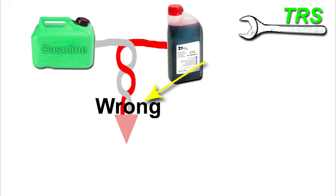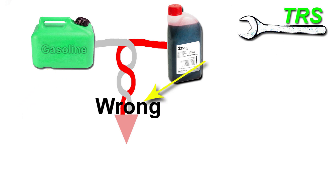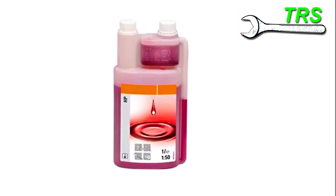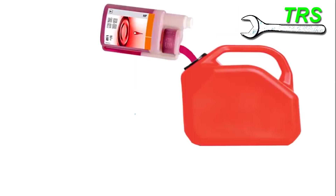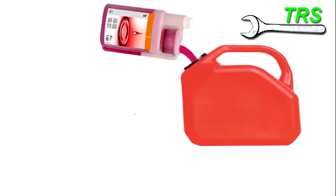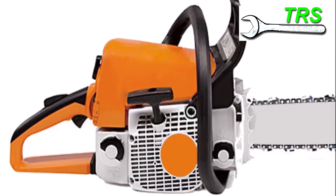If the ratio of oil to fuel is wrong for a particular two-stroke engine, it's likely to produce some sort of damage, so it's vital that we get this constitution right. We need to use a really good quality premium oil. I like to use it out of bottles like this — there's a little gauge at the top like a small tank that helps mix the oil with the fuel to the right constitution. I've included a link in the description if you want to find a good premium oil with this kind of bottle.